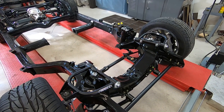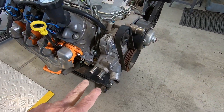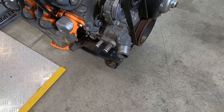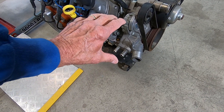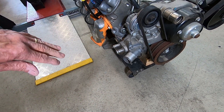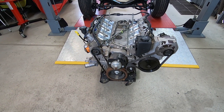This swap's been done many times before, but one of the issues that some people have is along the suspension parts — this upper A-arm. There's interference where the heater hose outlets are and also the radiator hose outlet. I want to do a fit check and see what I'll have to do to get clearance. I'm also planning on running an air conditioner on this car — a vintage air unit — and the compressor is going to mount right up here somewhere. I've already got my motor mounts bolted on the side of the block.